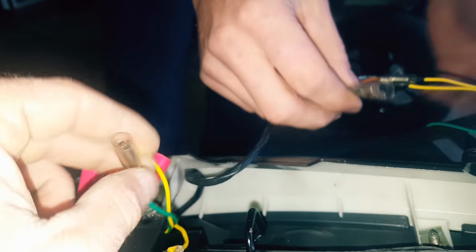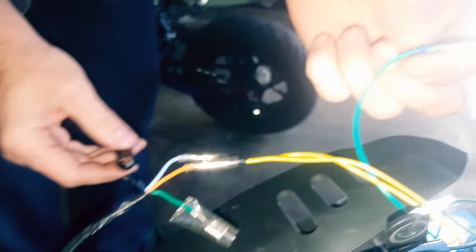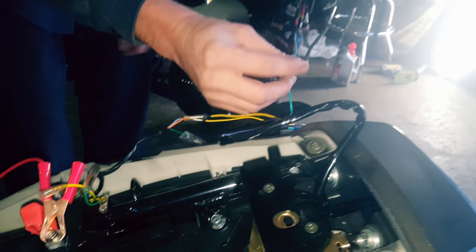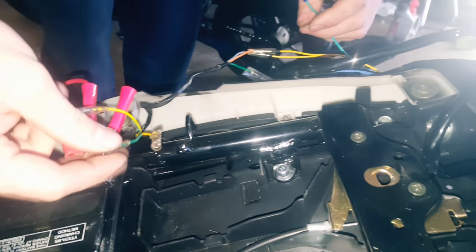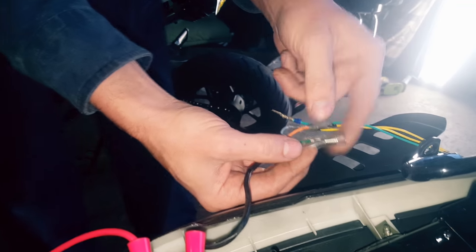Now you're done. You will not need to use all these extra grounds — you need one ground for this light. We already established that with the power probe, and this is the ground wire for the entire light — all the lights built into it come through this one ground. So you don't need to hook all these grounds separately. If there's another ground wire, just tape it off or leave it — it won't hurt anything, no power is going to it.